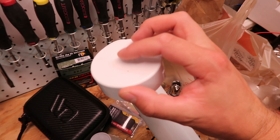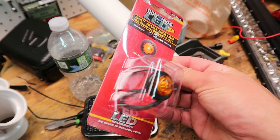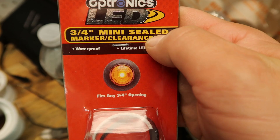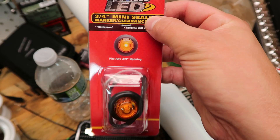The flat cover lets our light sit recessed down in there, which will make a much better fit. The other pieces I had from a previous project had a curved top and the light wouldn't sit down in there properly. For the marker bulbs, you can pick these up at your local auto store — I'll link some in the description. The most important thing is to make sure they're waterproof, sealed, or marine grade, because they're gonna get wet being on top of the trailer.